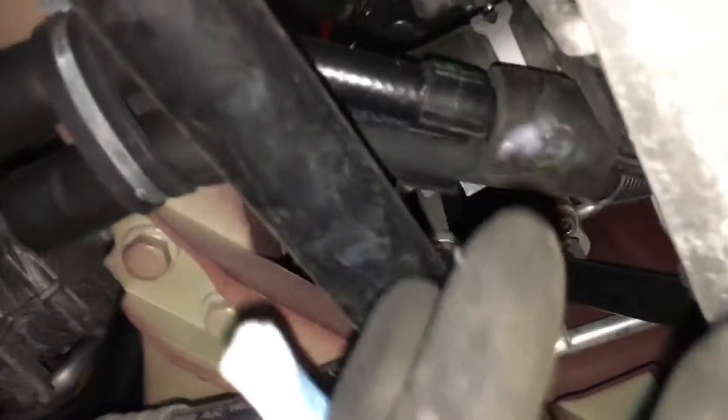Here's some of the piping, here's some of the air conditioning from down here. There we go — the gold, brass-colored component you see right there is the solenoid that turns off the refrigerant flow to the plate heat exchanger that has the expansion valve on it. That chills the glycol that cools the hybrid battery when you're charging or accelerating and heating up the battery. You have to get rid of all that heat, and that's done by the air conditioning system — which is also for the passenger compartment — coming back here to the glycol system.